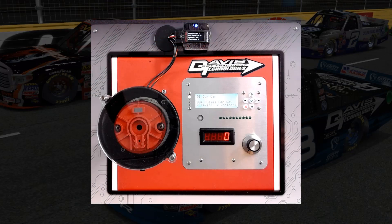Today we'll be using our race simulator, which we can take a recorded run from the racetrack, replay it into the traction control system, and analyze its results. You'll see here it has a standard racing distributor. Up top you'll see the traction control mounted, and then here you can see an LED bar graph that will indicate the amount of retard.